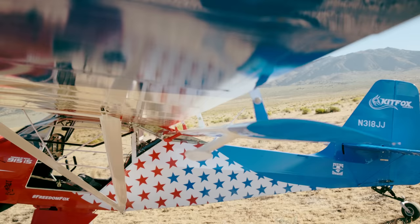Because the flapperon is detached from the actual wing surface and lowered down below it, the flapperon is flying in air that is being pushed off and redirected by the underside of the wing. So the angle of attack of the flapperon is not the same as the angle of attack of the wing. Because of that detached orientation, the Kit Fox is actually able to lift a stalled wing — because even when your wing is stalled, your flapperon isn't. Which means for the most part there really isn't a region of reverse command. It's very hard to spin a Kit Fox. I've never actually spun the aircraft, so I didn't think it was wise to demonstrate it on video for the first time.